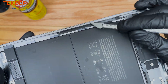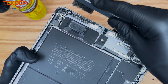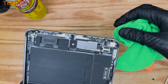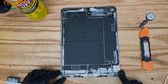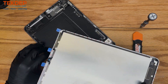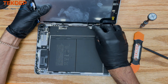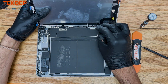It may feel like you're using more time than you need to, but ultimately it's going to save you time in the long run. I have obviously sped a lot of this up and even cut out a lot — this takes a lot of time. It really is a job of patience more than anything. From a technical perspective, this is actually quite a straightforward repair. There are only three Phillips screws plus the fourth on the battery connection, and only three flex cables. It's just a whole lot of glue, and of course the risk of that broken glass as well.